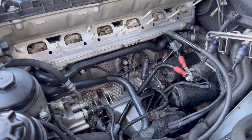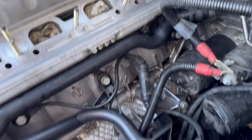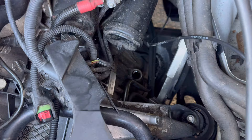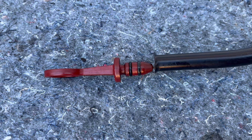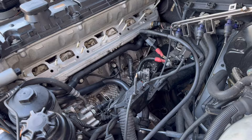I'm going to get those two pipes stabbed in — just going to lube them up with a little silicone, get them set and reconnected. Got both of them in place, 10mm up top, 13mm for the upper and two 13mms for the lower. Both hoses reconnected. I also pulled out the dipstick — going to replace that O-ring. Make sure when you replace the O-ring that you pull the old one out first. So I just went in there with a pick tool to get it out, got our new O-ring on there. I did goof and only ordered one dipstick O-ring, so I put the new one at the top — we'll replace the other one another day.